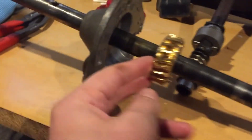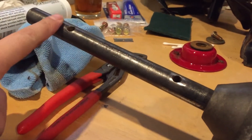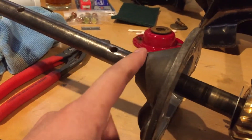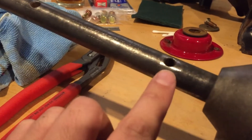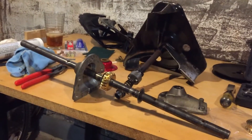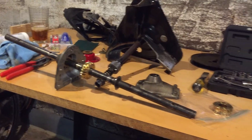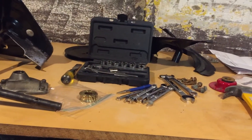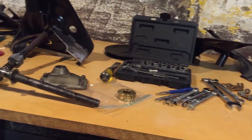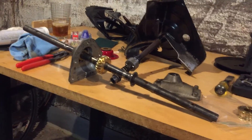But then I put the gear on forgetting to put the washer on the other side. So then I went back out to my bench grinder and just wire brushed down the rust on this side and was able to get this housing off. I had to do just a touch of grinding right there, just to slide the housing off. So everything's all set to go back together, and that's what I'm going to do right now. So far it's been pretty easy - just a basic socket set, hammer, punch, and some wrenches.